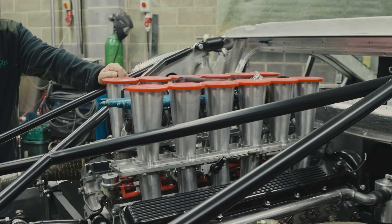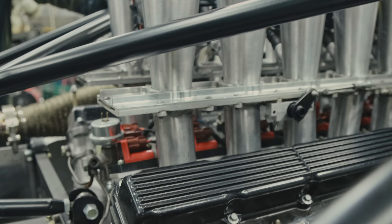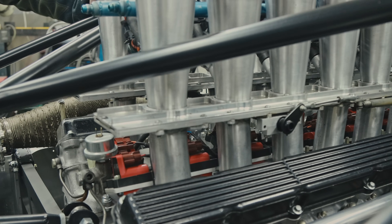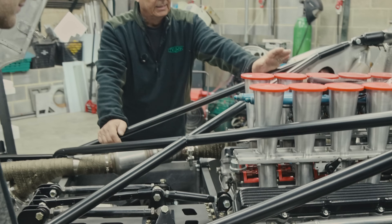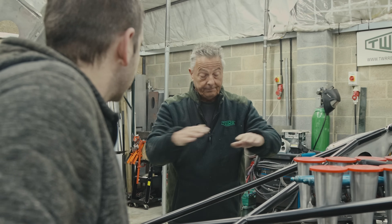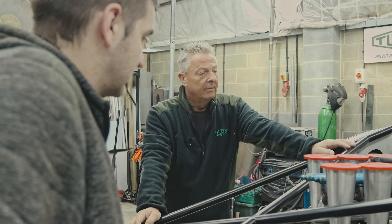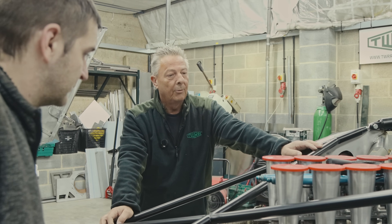I stripped them all down because they were banky - I was told they'd been sorted, but when I went to open them the first time they were crunching. So it was just muck in there. Everything's been cleaned out - they've got stripped needle bearings which the sliders float on, so they were all thoroughly cleaned, greased, and WD-40'd. They work a lot better now.